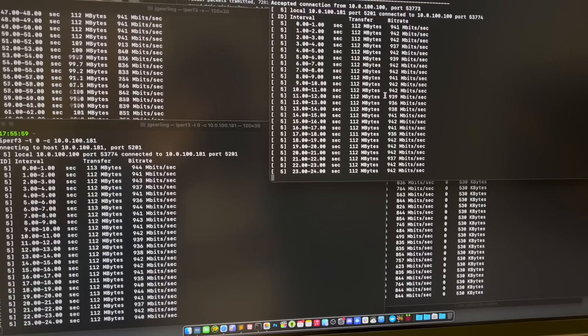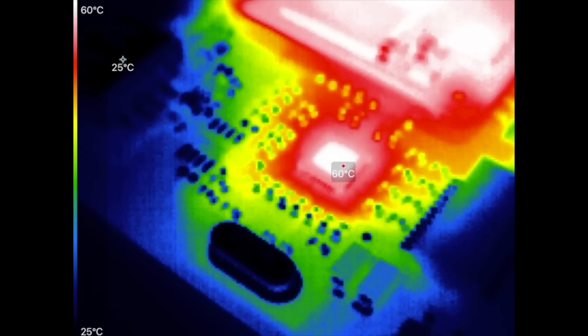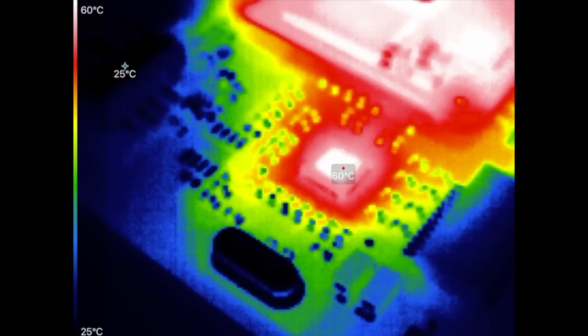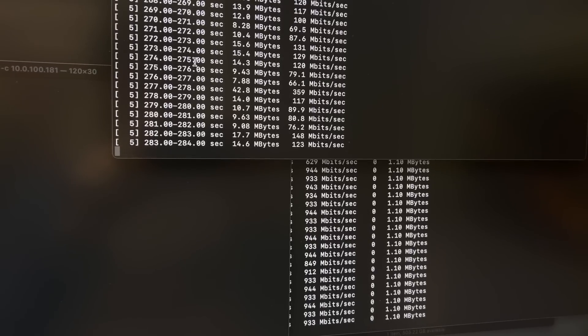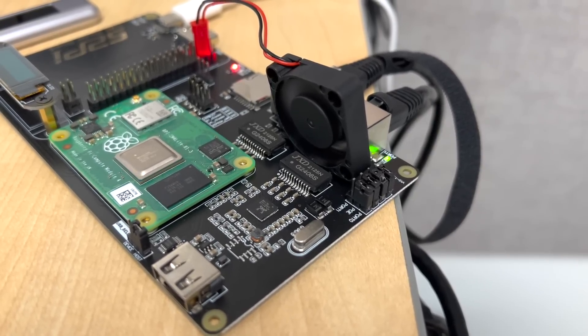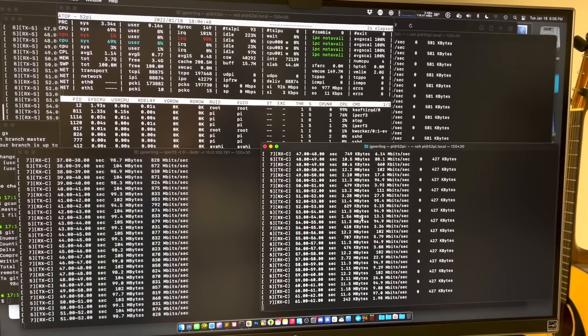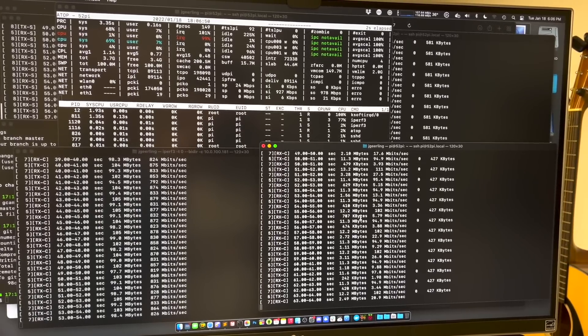Finally, I did a test putting through as much data as I could through both network ports continuously, and found out the second gigabit NIC gets really hot. So hot that if you don't add a heatsink or a fan, it'll actually slow down. My first run went from pumping through 1.76 gigabits to just 1.2. After I put this little Pi fan on the board, I was able to get 1.8 gigabits without any slowdown. So it performs adequately, and any other networking performance issues, like using it as a VPN or firewall, would come down to the Pi's own CPU performance, just like the other boards I reviewed last year.